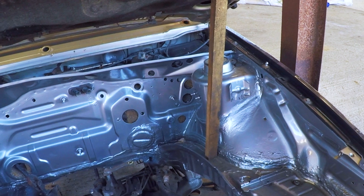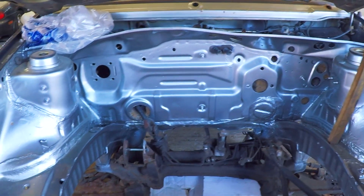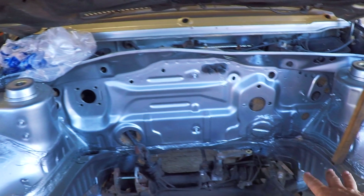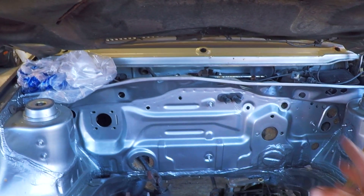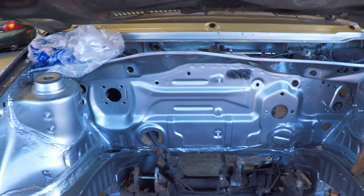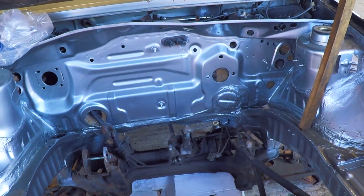The bay has already been painted, as you can see, so we're ready to push on. This was done up by Heart and Soul, who do most of our work here in the UK. I'm going to run the light loom and do the subframe. For power steering, this is a Mark 2 rack with shorter arms, but we actually have a Mark 3 power steering rack, pipes, and pump — it uses the green fluid. So we're going to ditch the old one, which is probably as old as the car, and fit something fresher and more reliable.